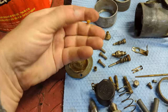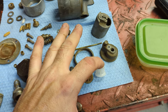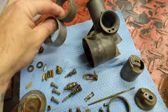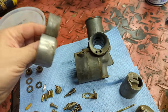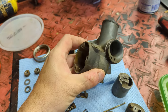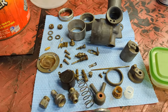It's a little crusty. It has one of the old style plastic float needles — I've got a good selection of viton tip versions to replace it with. The screen filter is pretty gummed up, but I luckily have a new one, along with a nice new gasket set. This is the original adapter for the pancake air filter — I've got a couple other options since I'm going to be making a custom air filter. I don't have an ultrasonic cleaner, so I'll be doing the good old chem dip and some carb cleaner to get this as clean as possible.